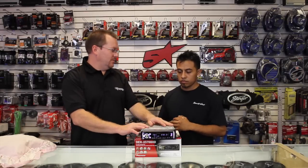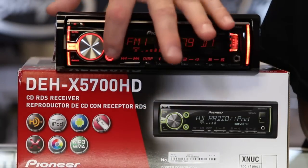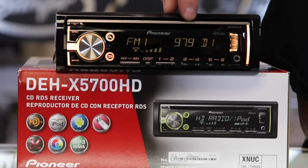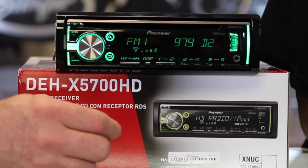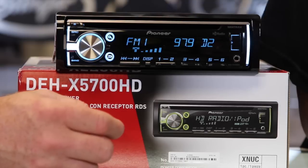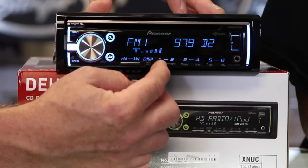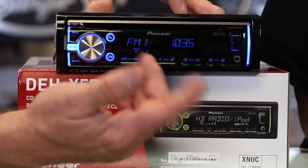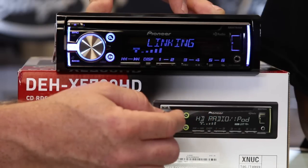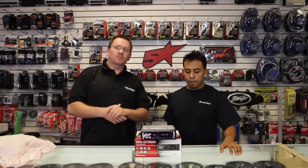This one has HD, so let's show how the HD works — that's kind of a key feature on this radio. We use these buttons to tune to a radio station. In this case, we've tuned to 98 Rock in our area. You'll see D1 — D1 stands for digital one. If we want to go to D2, we hit this station again and it'll come up and say D2, so now we're on the HD2 channel. We can also make them a preset: if we're on HD2, press and hold to save it as preset one. When you go back to preset one, it'll say 'linking,' which is the time it takes for it to lock onto digital, and then it pops right to HD2. That's how you work the HD tuner.